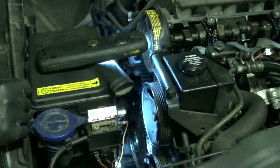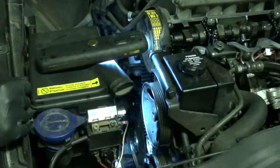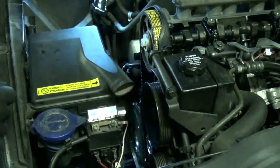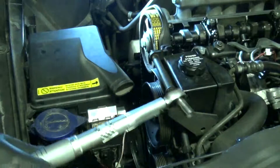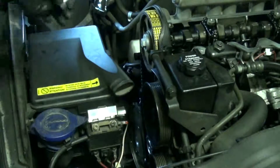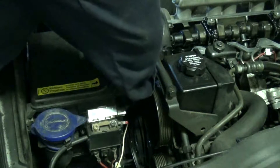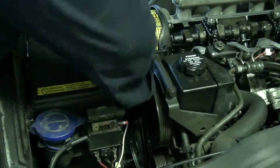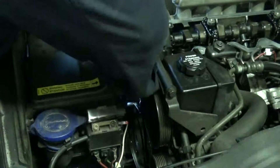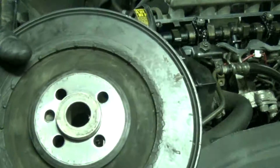As you start putting the front cover back on, keep an eye that there is a reasonable clearance between the covers and the belt, because you don't want it rubbing against the cover in service. I've heard of instances where things weren't quite designed right or there were common installation errors, and you end up with the belt slowly rubbing against the timing cover and actually shredding itself.